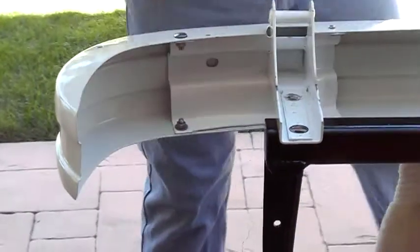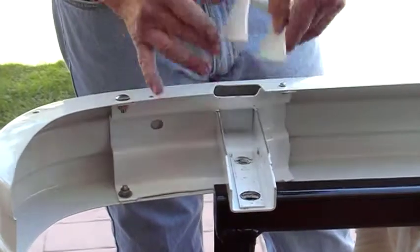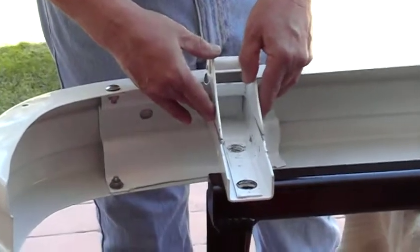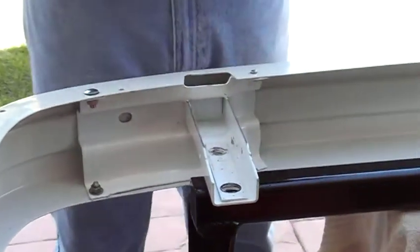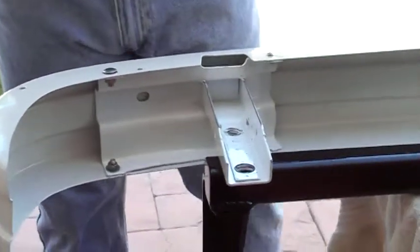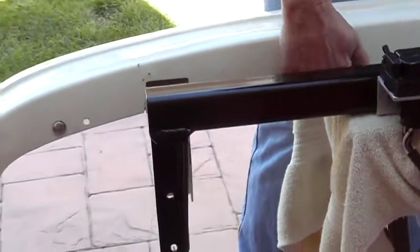I scribed a line straight across. Basically, you just make it look like this side. This has to come off, so what I did is I cut it nice and neat and straight. I'm going to keep this piece — if I ever want to put it back on to keep it factory, I can just set it there and put a nice weld and grind it off. Anyway, you've got to cut this off and save it, because when you do put the bumper on, those will be in the way.